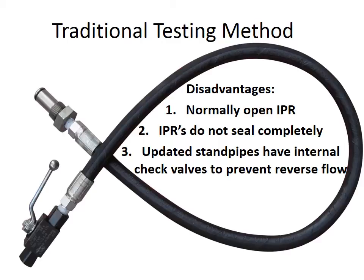Also, most scan tools will only hold the IPR valve closed for a very short period of time to prevent the valve from overheating. It can be nearly impossible to locate a leak audibly during this short time window — about the time you climb up on top of the engine to listen, the scan tool times out and you have to climb down and reactivate it again. Very frustrating. Small leaks may require that the air pressure be applied for some time in order to push the oil out before the air leak can be heard. This may not be possible during the short cycle time allowed by the scan tool.